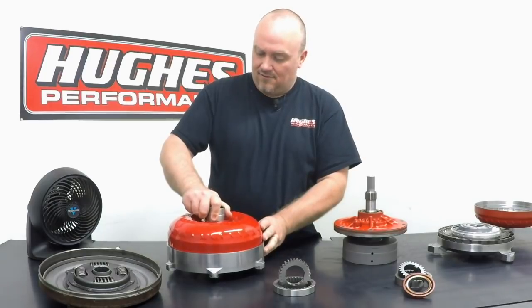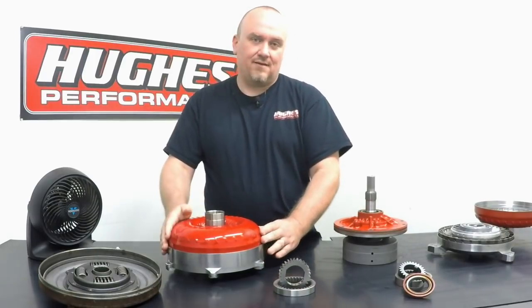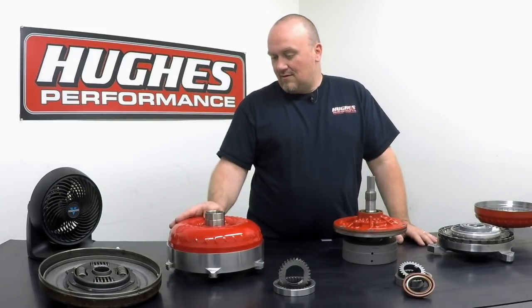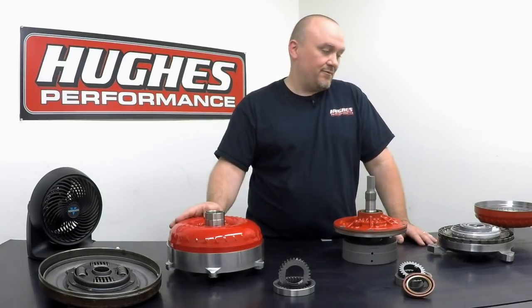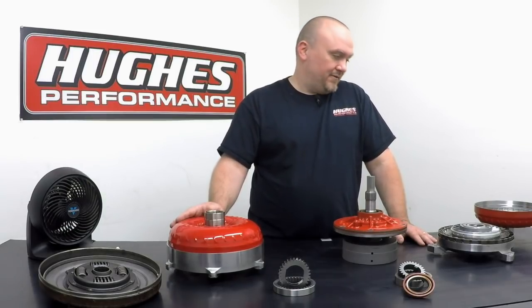Again, not all OEM converters have that feature. Interestingly enough, it does date back to OEM technology in the 60s with Mopar. Their Hemi torque converters, the 11-inch models behind the Hemi and max wedge engines in front of the Torqueflite transmission, were all furnace brazed right from the factory. Racers picked up on that and adapted the technology to their aftermarket converter builds.